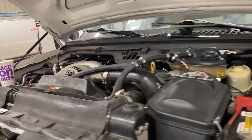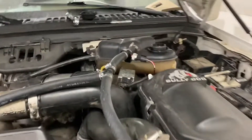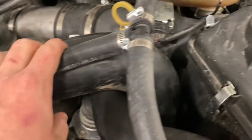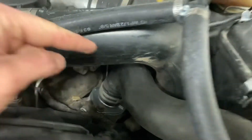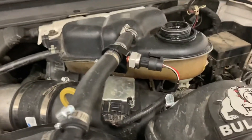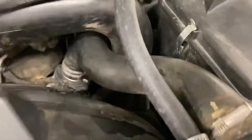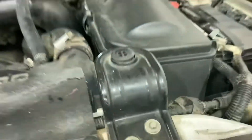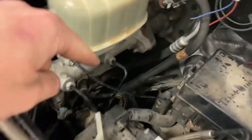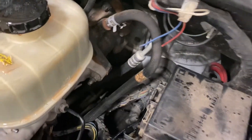Skipped ahead a lot without updating you — here's the old thermostat; the new Ford one is in. It's pretty easy, just two 10-millimeter bolts. I did it without even taking anything off, though it's definitely easier if you remove the air intake to get the clamp on. The new Ford thermostat is in and I refilled the antifreeze. I had to go to O'Reilly's for new hose to fit it because the blue hose that was on it was way too small. It's all plumbed back to the filter. There is a tiny little hole down there that still needs to get finished up.